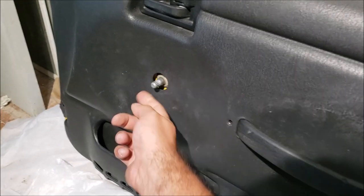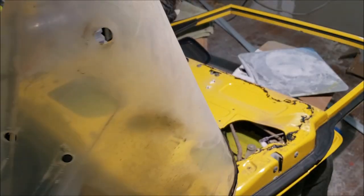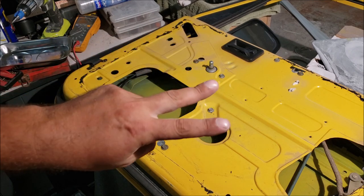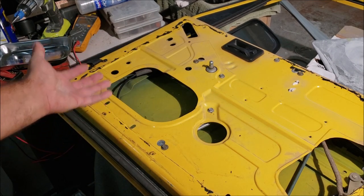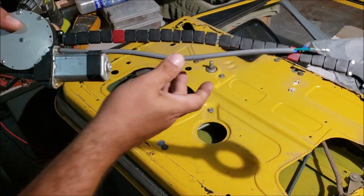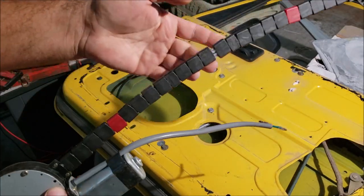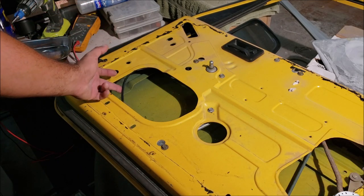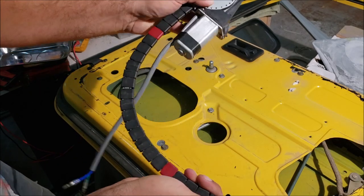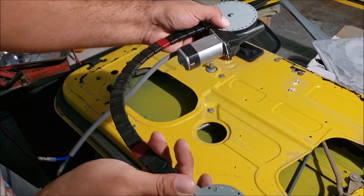Since the motor rolls the window up and down, the biggest thing to consider is the hole in your door panel with the stud sticking out — what do we do about that? Get your door panel off. If it had a weather shield, do not throw that away — reuse it. Steps one and two are super critical to determine if this kit will even work. This style has a motor and cables that drive a gear. A lot of factory vehicles use cables just like this Jeep. The instructions will specify a maximum bend — this one said 300 millimeters minimum bend radius.